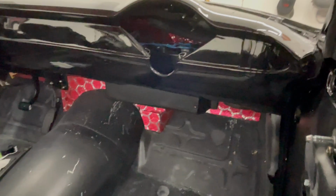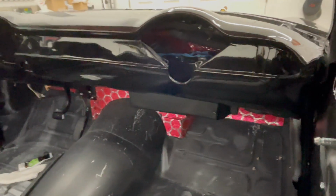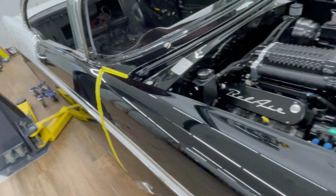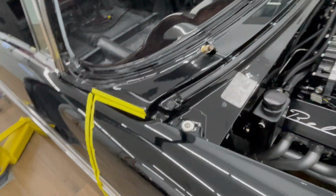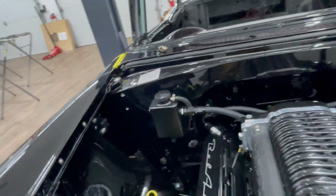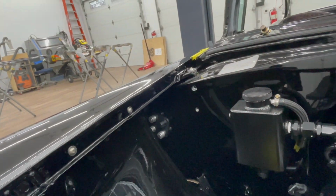Slowly getting there. The AC unit is in from Restomod Air. It's a very tight fit. The access panel is actually here on the other side of the fender. It took several days to get that installed. I actually had to make the lines as I installed it. I ended up crimping them outside the car and then running them through. Huge pain, but they're actually capped off right there. They're all fit and tight, so they'll actually run through the fender.